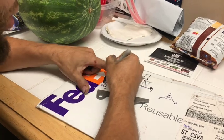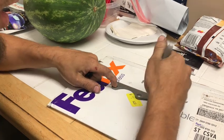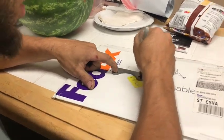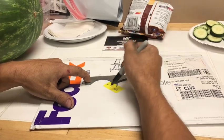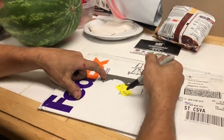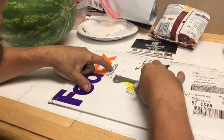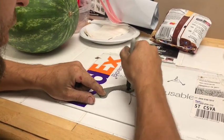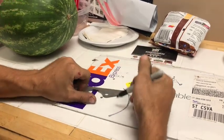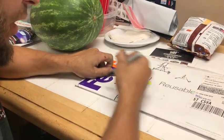This is the attachment point on your chassis and this attachment point on your rear end. If you only have a couple inches of short travel, that distance from here to here is small. But if you have a lot of suspension travel, that means the rear end has traveled from left to right in the chassis — the panhard bar is pulling the rear end laterally.